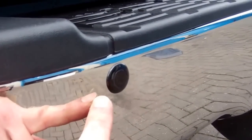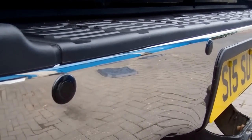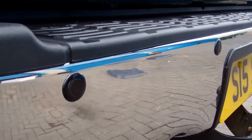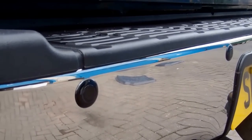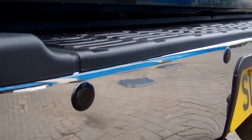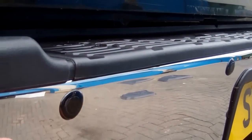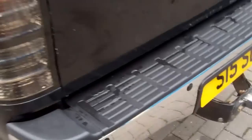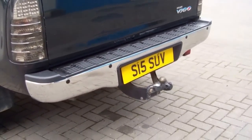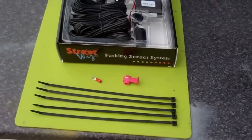The outer skin is completely stainless steel. We've had these produced for us with pre-cut holes to take a set of parking sensors that we supply with the bumper. We did try drilling the stainless steel bumper and it's very, very difficult, so we gave up on that and went back to the factory to have them made with holes cut ready.